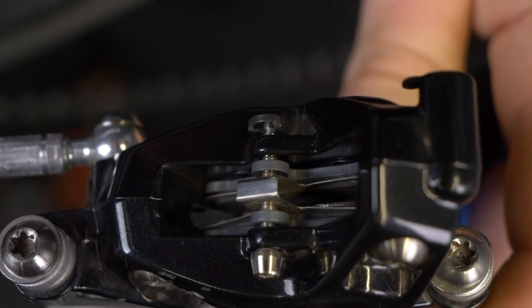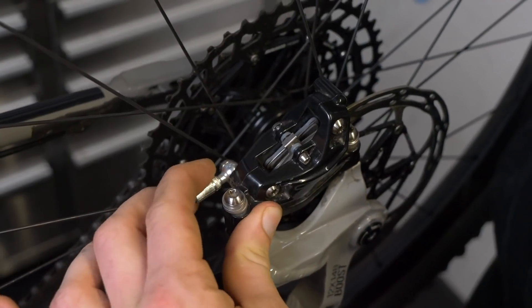So this has got two elements to it. In regards to different tutorials online, if you've got the five best chefs in the world and you ask them to cook you a steak, all the steaks would probably be delicious but cooked very differently — and I think it's actually the same for bike maintenance. There are some things you should never do, like pouring WD-40 all over your rotors, but a lot is open to interpretation. For me, I just like to get my calipers centred well — all the pistons are nice and active; you don't want just one piston doing all the work. Then I do some rolling to some firm braking and repeat.